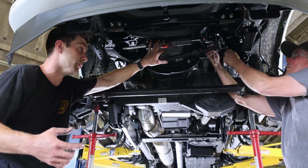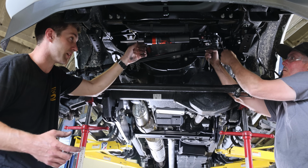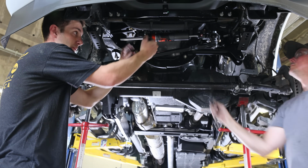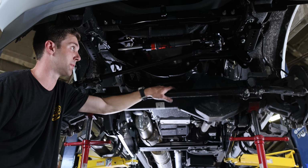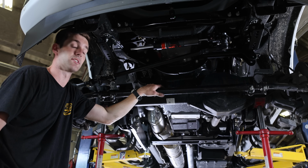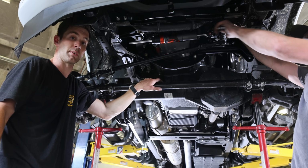So no matter where we are in the suspension cycle, whether you hit a bump or whatever, this stabilizer never moves. There's a factory stabilizer mounted in this hole right here, and every bump that stabilizer is basically fighting the suspension as it comes up and tries to compress that stabilizer, whereas we're never going to have that here. So fully adjustable ATS, rigid mounted to the pitman arm, replace the pitman arm itself, pitman arm nut, and then we replace the bracket over here to mount this in here. Great system, nothing else drives like it. Keeps the wheel real steady in your hand and gets rid of all bump steer.